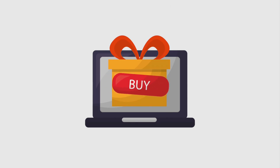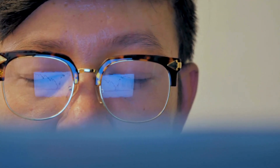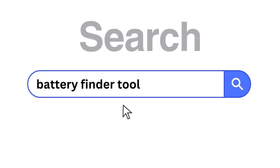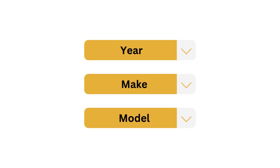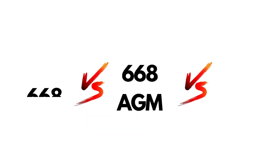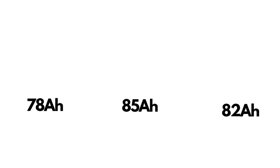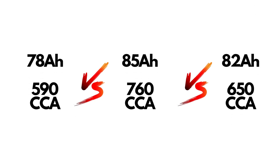The last step — and for those that don't have any information available on the currently fitted battery — is to use one of the many tools available on the internet to get a general idea of the recommended battery for your vehicle. Simply go to Google and type in 'battery finder tool.' Most of them will require you to fill in the year, make and model of your vehicle and perhaps the model variant. You might get different results from different tools because there might be an overlap of two different models in the same year. Compare a few results on the required amp hours and cold cranking amps to determine a recommended battery. Also consult your vehicle's owner manual for the battery size, or simply type your vehicle info into Google and scan through the images tab to determine the size.